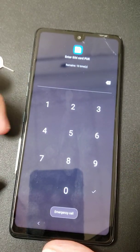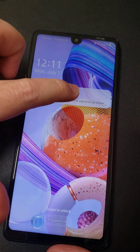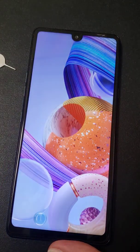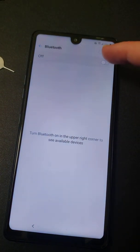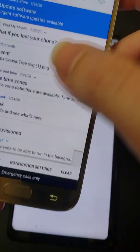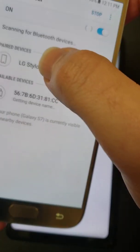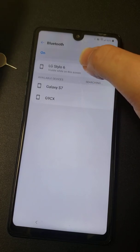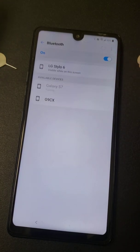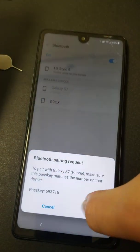See how fast that was? As soon as it's on the screen, pull it and do a full removal. Once you're here, you're good. Hold down Bluetooth and turn the Bluetooth portion of this phone on. Come back over to your other Android. Go to Settings, then Connections, then Bluetooth. You'll see it's already been paired. Hit the S7 — or whatever device you're using — and it should ask you two things; hit OK on one and Pair on the other.